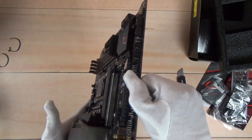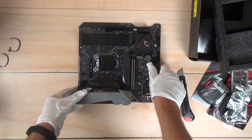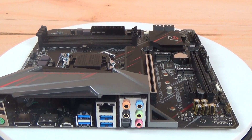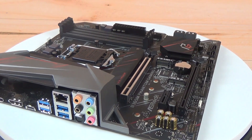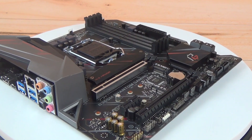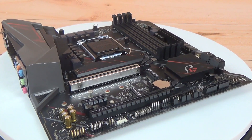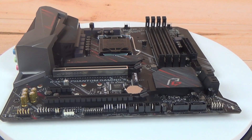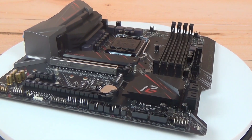This motherboard is an excellent piece of product, but it seems a bit expensive for budget processors. However, for this extra price we are getting much more — it has 2 PCIe X1 slots and 2 PCIe X16 slots, and supports AMD Crossfire X in a quad-way, though we don't need that with this budget processor. The VRM cooling of this board is excellent enough that you can reach the max boost speed, however you might need to go with some aftermarket cooler because the stock cooler will become much noisy. In the end, if you are willing to spend $100, this is one of the best MOBOs you can get for i5-9400F.